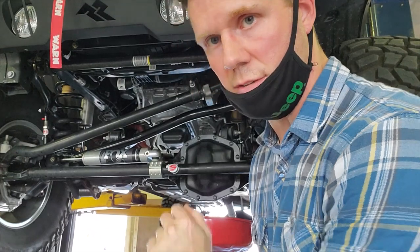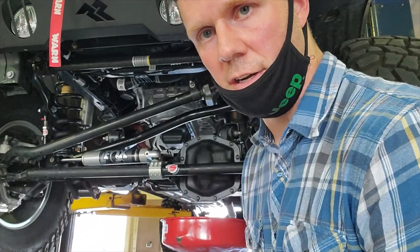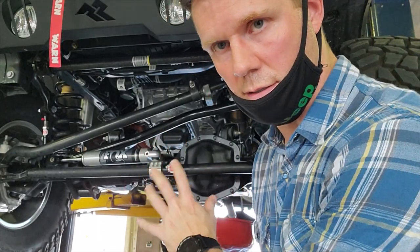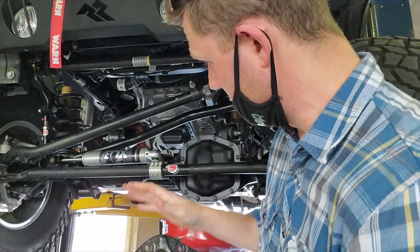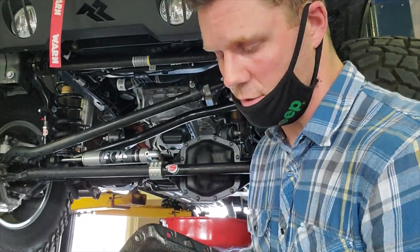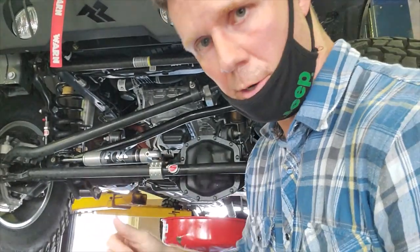This is the same as a Rubicon — the sport has the same axles. I've already upgraded to ARB air lockers and 35-spline axle shafts, so it makes everything beefier. Not to say the Rubicon is not beefy, but this takes a sport and takes it to the next level. The Gladiator Rubicon is a good start, but if you want to take your axles to the next level, those 35-spline shafts are much larger. Let's get to it.